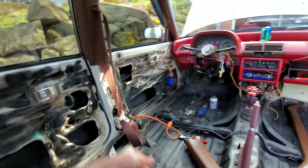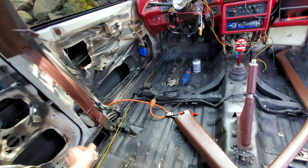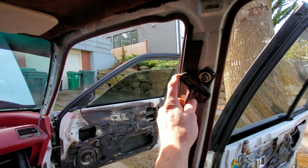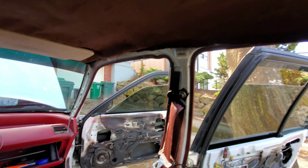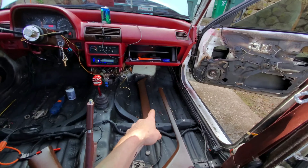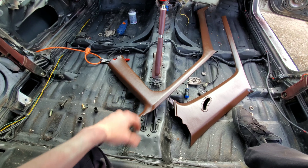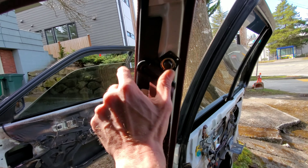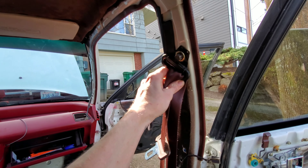I just finished the seat belt swap — this one doesn't want to go back in quite yet, old spring on that. I ended up reusing the 1990 molding. I dremeled a little slot over here — you can see I took the casing off of it, the tan slider casing, got rid of the 89 molding and brought back the 90 molding that doesn't have the slider in it. The slider piece on the 89 is on the rear and it was bowing the whole piece out, so it just wasn't fitting. I put it at a bit of an angle so that it slices by the molding right here and doesn't hit on the inside.